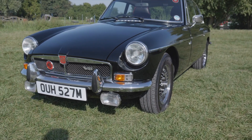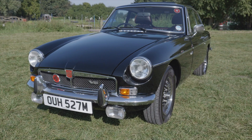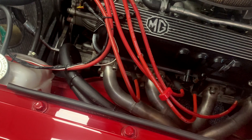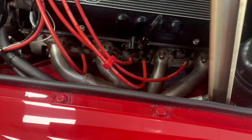In original form, the GT V8 had cast exhaust manifolds — over time they crack. It's not an unusual situation and you'll often find that they've been repaired, but that still doesn't last. The best route is to fit tubular manifolds, and you'll find most cars will have that now. It's quite rare to find one with original cast manifolds.